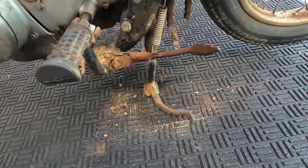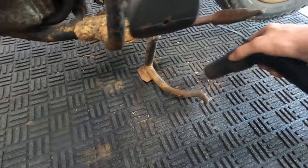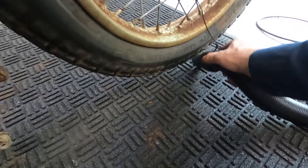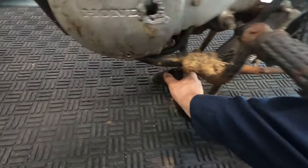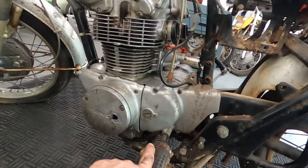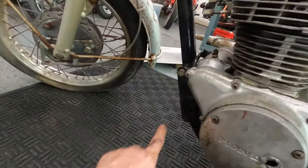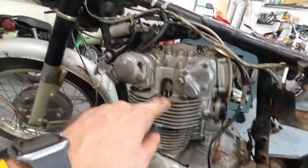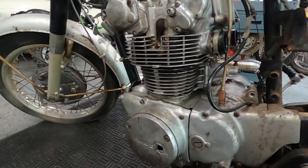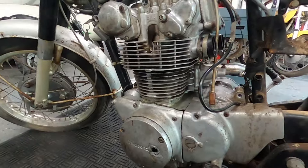Let's finish sucking up the rest of this rust. Now we've got to pull this cover off. Make sure the chain is off the sprocket — it looks as though it is, but we're going to go ahead and remove it anyway. We have to disconnect the starter, pull off this front bracket, and then we should be pretty free. We'll check — we may have to disconnect some wires once we get this. Let's go ahead and get this done. There should be some wires coming up.